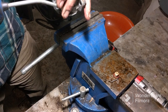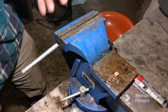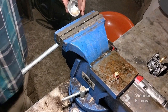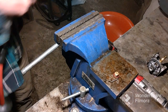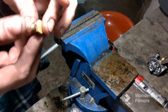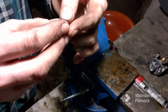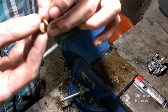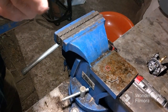In the bowl there was a little bit of dirt in there, so that's what made it run rough - running and just dying. It was all plugged. This is very important too - there are holes here. Be careful when you take that gasket off. Screw off past the threads - do not pull across there because you'll destroy them. Then there are holes; make sure they're all unplugged.